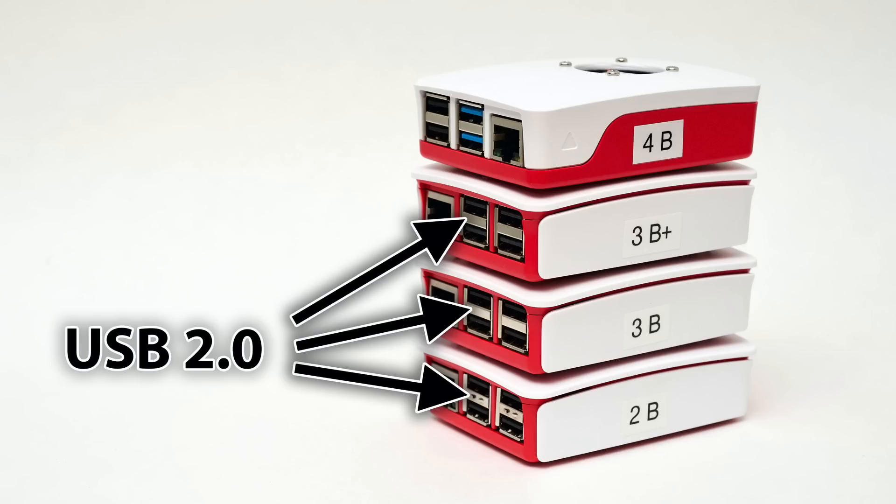For a long time, the main complaint I've had with the Pi is limited I/O speed, especially for the main boot volume. On older Pis with the maximum external disk speed limited by the USB 2 bus, even USB booting didn't make a very big difference. But the Raspberry Pi 4 not only separated the network adapter from the USB, it also has USB 3.0, which can be 10 times faster than USB 2, at least theoretically.